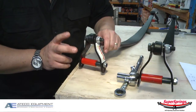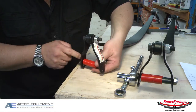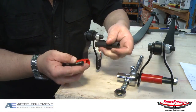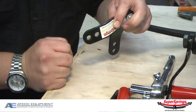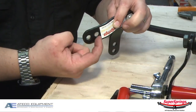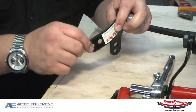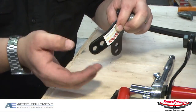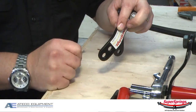Before we actually mount the Super Spring to the vehicle, what we want to do is take out the shackle bolt here and the roller bush in the sleeve — you can see that they're two components, so make sure they're kept together — and we'll just leave those sitting there for the moment. You can see on the shackle here there are two mounting holes. It'll come bolted into the top one, but you actually want to install it in the bottom one. The reason for that is that's your lowest setting, this is your highest setting, and what that means is it's going to change the ride height and the weight loading of the vehicle. So start in the bottom one, and you can always move it up to the top one later on.